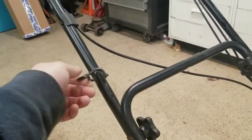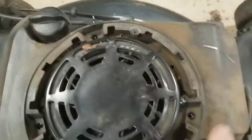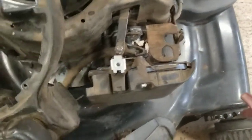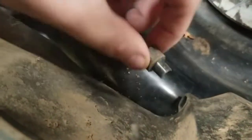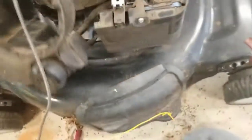Off camera I just bent this a little bit to get the rope out. There are three screws on top and a little bolt down here — you'll need a three-eighths inch socket for that one. Then this whole fuel tank assembly lifts off. Be careful: there's a little spacer here that can fall out, so set that to the side. Now I'll use a pair of pliers to remove the clamp and fuel line and get the whole fuel tank off.